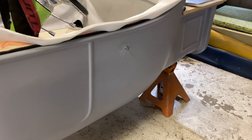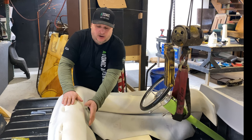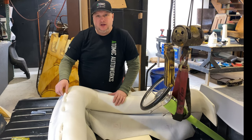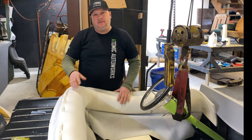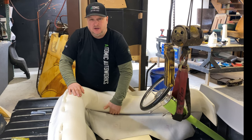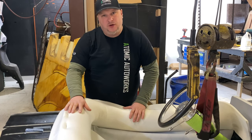If you have this car and this interior kit and you're trying to install it yourself, you always want to make sure that you have all your convertible top provisions installed. We already have this mounted metal on the other side drilled and tapped, ready for convertible top bows. One of the big things is to make sure you have your foam height for your rear bolster for the roll right. With your bottom tack strip, you want to make sure you put your tack strip in and it's even on both sides of the car — even from the top fiberglass on both sides down to where your tack strip is. You also want to make sure it's perfectly straight. As you screw the tack strips in, they're going to want to have a bump, so you screw to that tack strip and put a lot of screws in — about every half inch — so the tack strip lays flat. When we go to pull this up afterwards, we'll have a nice crisp edge across the bottom.